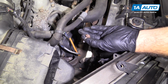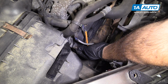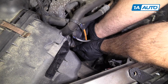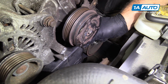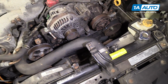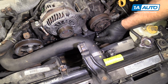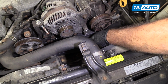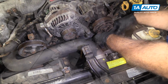So I'll take these shouldered bolts and start threading them in. Just line up. Just gonna go along and get all these bolts caught, and we'll come back and tighten them. Just gonna go along and tighten up all the bolts. These don't have to be over tightened. Once you feel them get tight, you just stop and go along and find all of them and tighten them up.